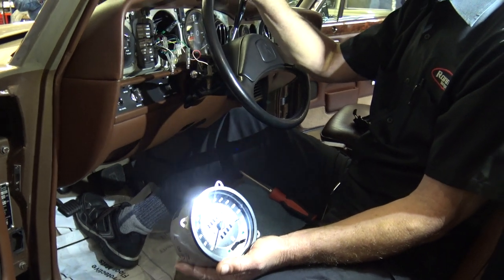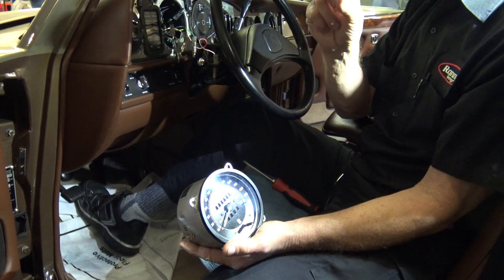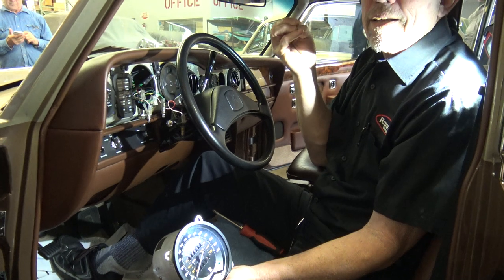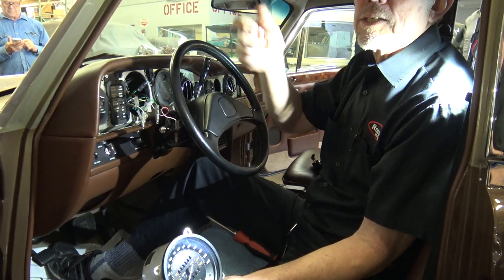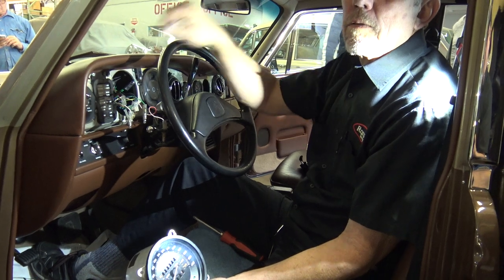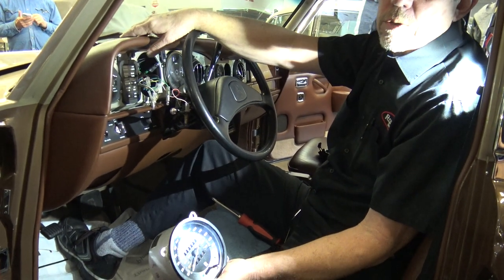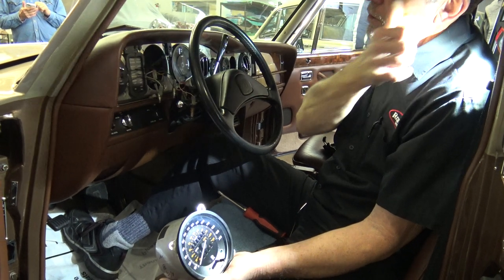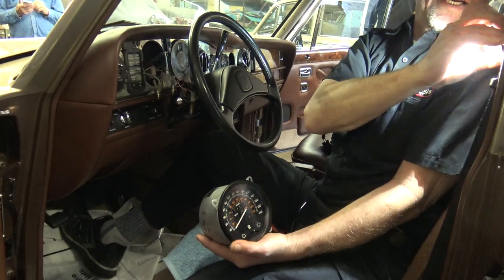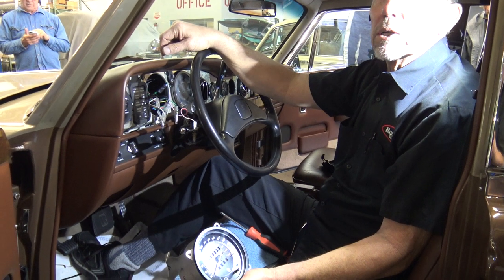So I got an email from somebody in San Francisco this week asking about fixing the speedometer. I told them where to go up there to have it fixed, and they said, well, how do I get it out? Who do I take it to for that? So that's why we're doing this video. And then you said because it's a Silver Shadow II, it's probably been out already — is that because it fails? Because the plastic gears with age fail, especially a car that sits around a lot. The elements get to that old plastic, and as soon as you start driving it again, it gets stuck and pops and just cracks. Real common problem. To find a speedometer shop — I always recommend if you're in the club, talk to a club member; they usually have resources. There's a local guy, and there's also a guy in L.A. and a guy in Palo Alto. There are specialists that do this kind of stuff all over.